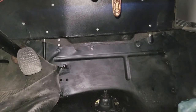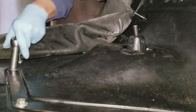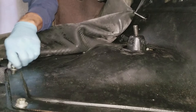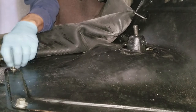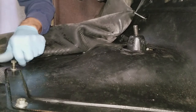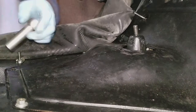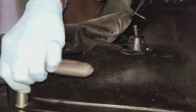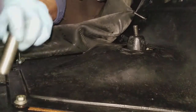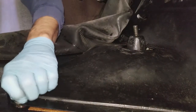Now there's a whole series of bolts all the way around the outside edge. The lower bolts are a different size from the upper bolts - lower bolts are 9/16ths head, the upper bolts are half-inch head. So just working on this with a ratchet and gradually going around removing them all. I never put these in overly tight - they're just nice and snugged up each time, so I don't wear anything out since this will be done whenever you might want to service something relative to the transmission.